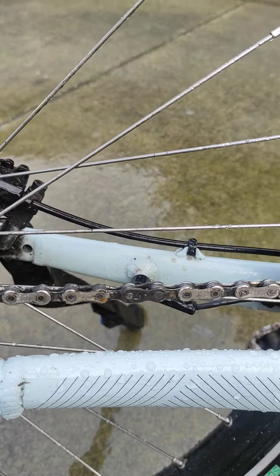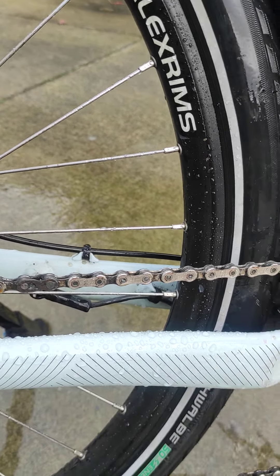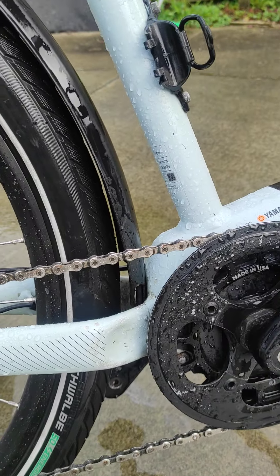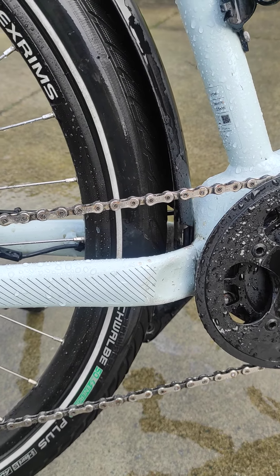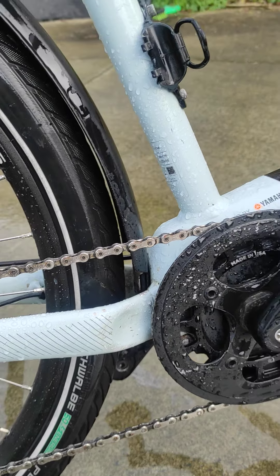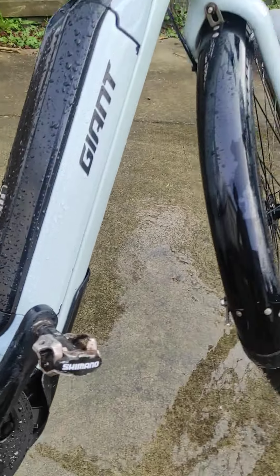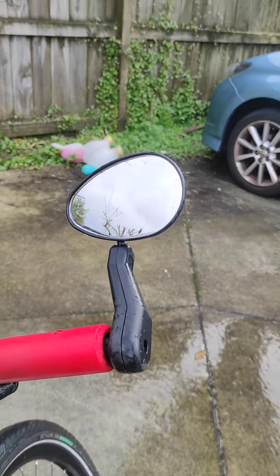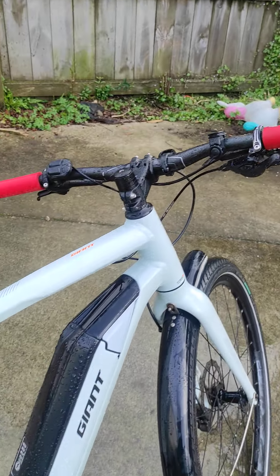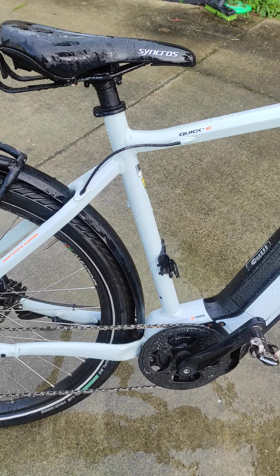Okay, so see that — that's how you want your chain link, and you need chain link pliers. So yeah, that's why you should clean your chain and degrease it properly every week if you ride it regularly. If you have a mirror, clean that every week too because it gets crap on it and becomes blurry. That will save you a lot of grief on a mid-drive e-bike.